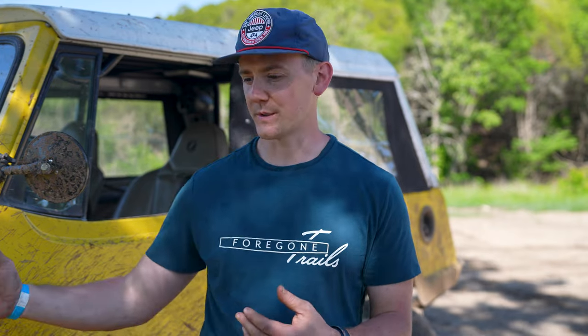I mentioned this morning we were avoiding the weather, so we came here to Crossbar today. Weather's been great — it was nice and sunny. As you probably saw, I had a mishap in the front. The birfield joint on these axles broke. I was able to get it pulled out, everything fixed, and drove back to the trailer without a hiccup. But it was a great reminder to understand the capabilities of your vehicle — know when you need to stop and back up, reassess a little bit. Even if it's a little off-camber and you're a little uncomfortable, just stop, take a break, take a deep breath, and assess the situation. After running it through in my head, I think what was happening is my rear diff got hung up, and the Jeep was pulling and pivoting to the left — just too much pressure and torque to really handle that birfield while I was turned to the left. If I would have just stopped, backed up a little bit, moved over a foot, and then gone for that same spot, I probably would not be in this situation today.